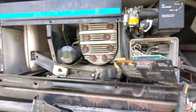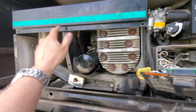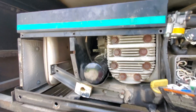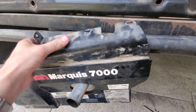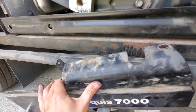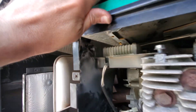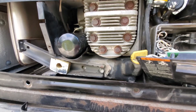I didn't know where those were or how to access them. So first off, the oil pressure switch — you've got to take this front cover off. I assumed I could just take these seven bolts out and pop that cover out, but that wasn't the case. You've got those seven, but then you also have to take this top cover loose — two more up top, two more on the side. The top of this front cover has holes for three more bolts. Once you pop this up, right on top of the motor or engine, there are two half-inch bolts and one more 3/8 bolt on the side. Once you take those loose, this cover can pop out of the way. And that gets us to the oil pressure switch, which is located right here.